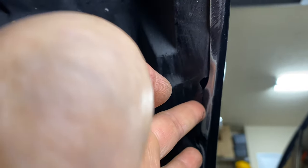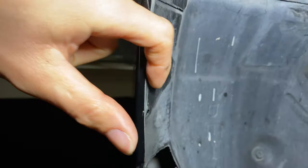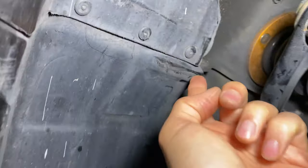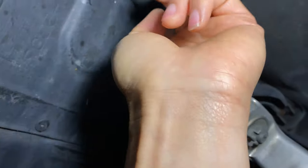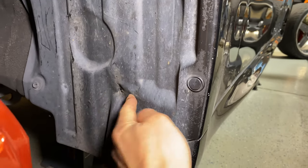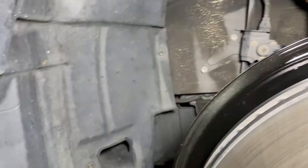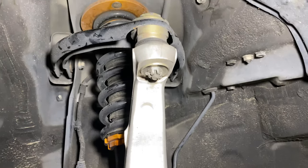Once you break that tab, you see guys using two hooks with a rubber band, which doesn't look great. Overall my fender liner has been pretty much intact its whole life. I've lost the two clips on the top side, but that's not an issue. I did have to bend the tabs back on either side so they wouldn't rub. Other than that, the only modification I really did was heat this up with a heat gun and push it back where it was rubbing a lot.